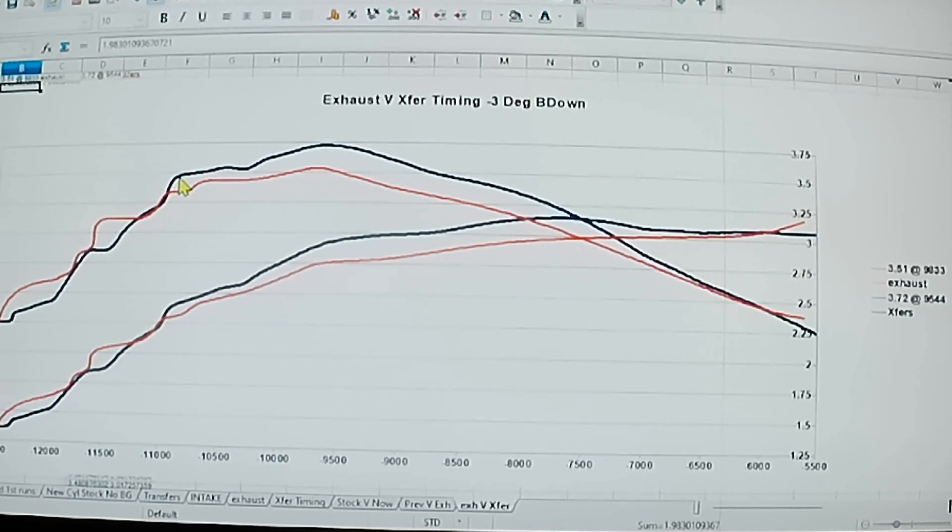Next things left to do: muffler mods, heat measurements and rolling resistance — what it takes to turn that saw over with parasitic drag — and a one-ring piston. We're still shooting for just about four horsepower, maybe a little better. Spoiler alert — I don't have it on here, but I can show you the tracking number of a new cylinder because I ruined this one.